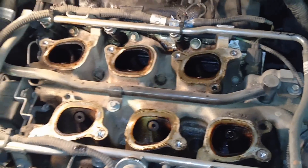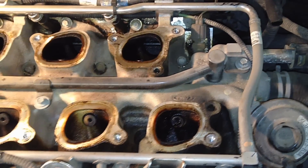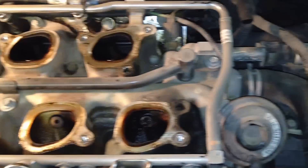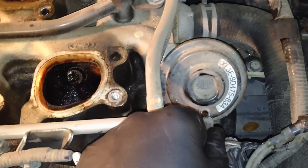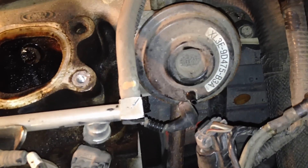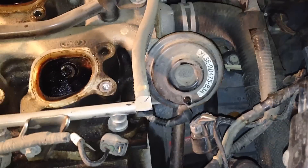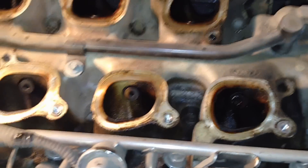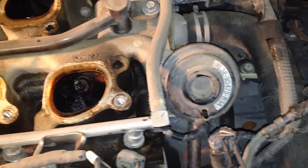Without pulling the upper intake, here's what you can do if you're getting misfires only when the EGR kicks in and everything else — ignition system — checks out: with the engine on or off, pull the vacuum line to your EGR valve and leave it aside. Go for a drive under the same conditions and test it. All of a sudden the misfires will be gone, because you've cut off all that gas being dumped into that one cylinder through that channel.